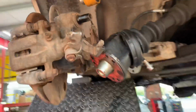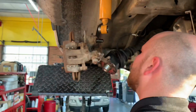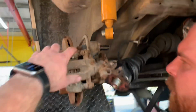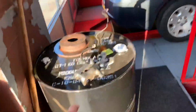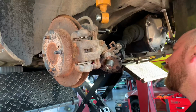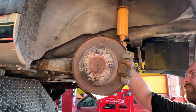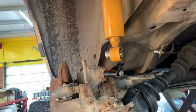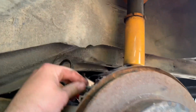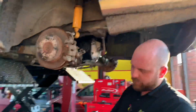I like it. And you might even consider going with the metal line that's on this one, because I remember when I put that other arm on, the retainers for that little metal line were a little different. I had to bend it differently. So of course we're gonna go with our newer hose because we've replaced this on ours. Yep. So go ahead and use that hose on the new one with the old caliper. But that metal line that's routed along the arm, you might want to stick with that. Just leave it on there because it was a little different. Yeah. Okay. Sweet. But yeah, I think if you clean up that old rotor, you'll have to get that little. Oh shit! No, it disconnects right there. It goes all the way to the caliper right here. So you'll just have to put our, I think that's what you should do, because I'm pretty sure the one that was on there is a little contorted to make it work.